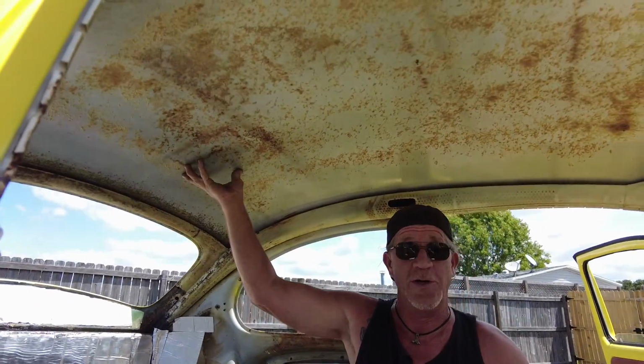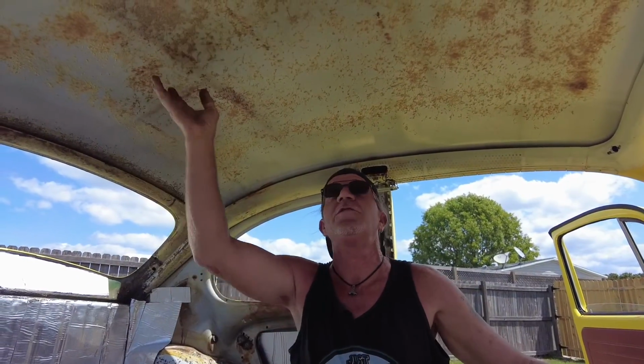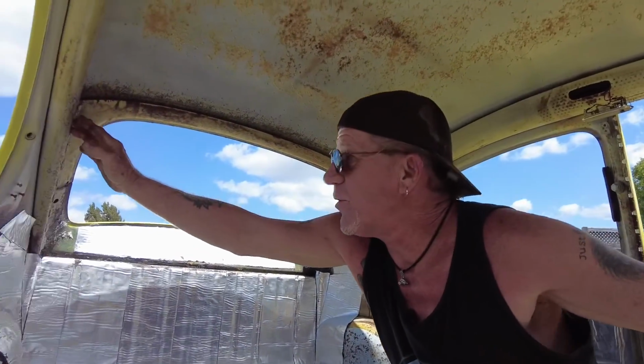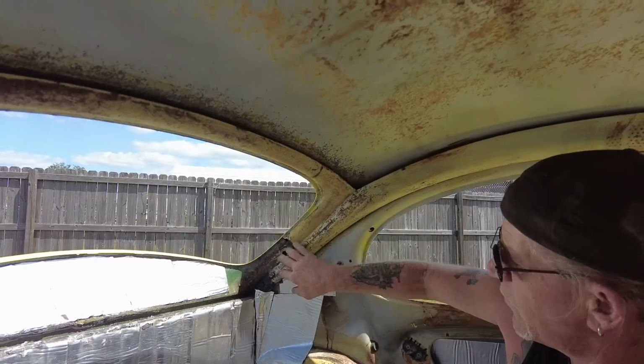You ready? Well, we're going to start with, of course, we've already cleared the old headliner out. You're going to want to do that first and get everything off of it, and then clean up all your clips here, your grabbers.